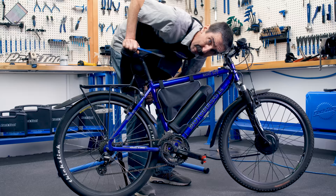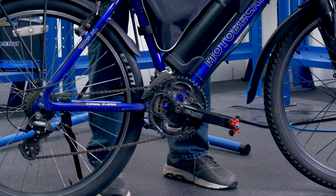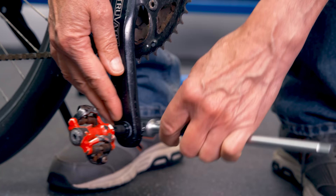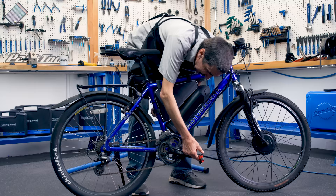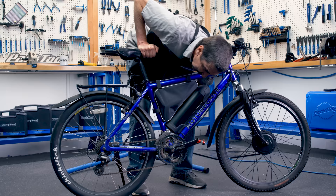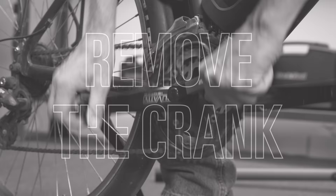Sometimes the ground can be a good work stand when you're leveraging with a stuck pedal. On this rig we're told that one's really bad. If I took this wrench I could have good leverage pushing down with body weight, but this pedal can't use that — it doesn't have an outside wrench flat. It's got hex sockets in back, and that's where the hex tool comes in handy. But this can be a problem with a stuck pedal; you don't have many options. So we're going to get that crank off the bike and put the crank in a stand.